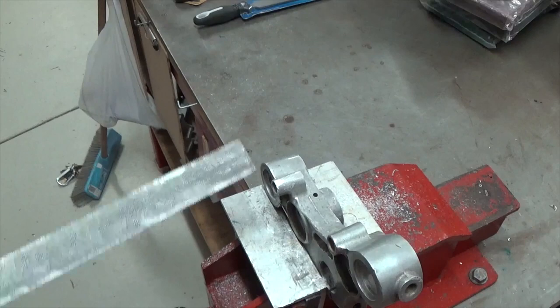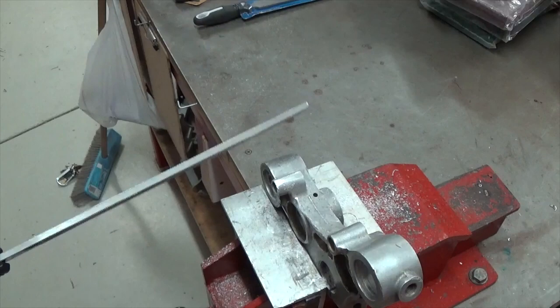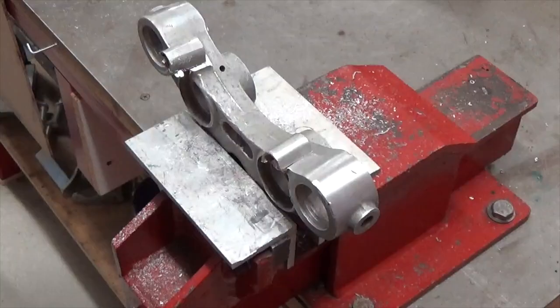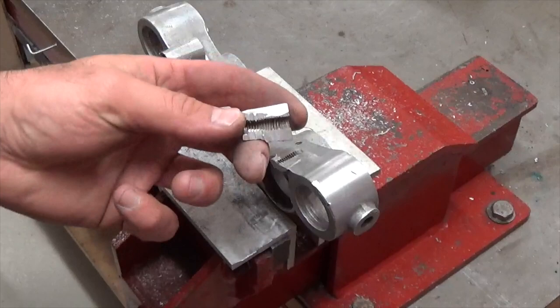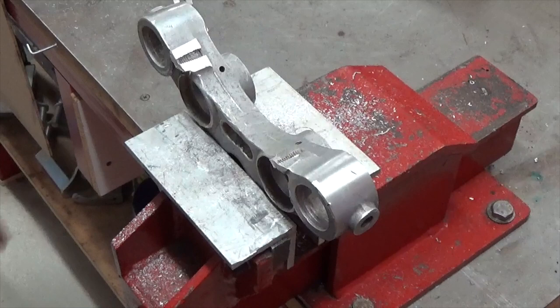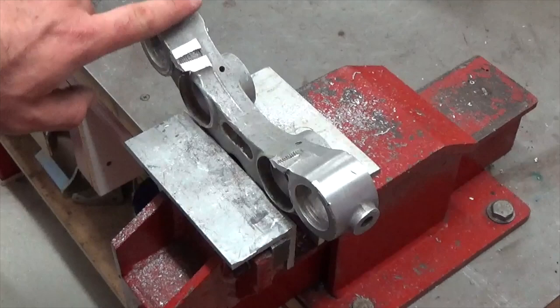You can see how slowly this is being removed. You can also see that if I slip and hit one side or the other of the triple I'm going to put dints in it with the file. So I think I will go and cut these off — hacksaw or angle grinder, just rough cut them off. That'll make things a little easier and probably speed things up too. So I've gone and cut these pieces off with the angle grinder, roughly within a couple of millimetres of the surface. I'll get back onto the files and flat file here and smooth this off, then use the half round to clean up the curved section.